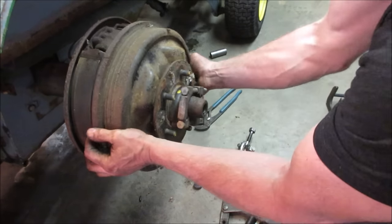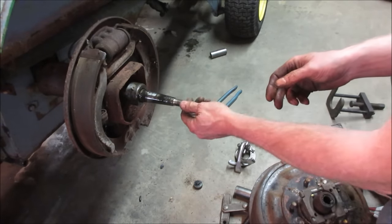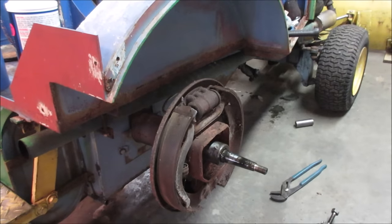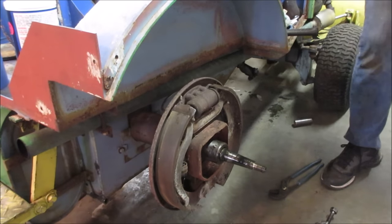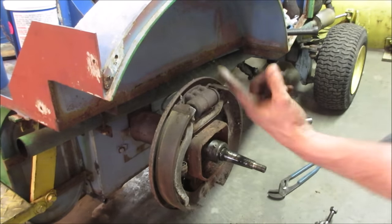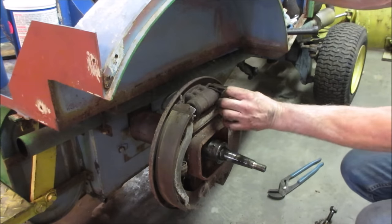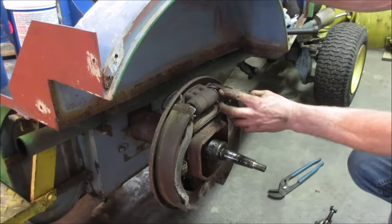You know, that's going to be nice and light, right? There we go. All right. So yeah, there's the taper shaft I was talking about. So we want to look at that wheel cylinder and hopefully we could save it. Let's go hit the brakes and see if anything moves. Yeah. So both of them are froze. And the other side, I guess, is working, but this was the same. Doesn't this look like the same ones that were on the Dodge? The Plymouth, rather? Yeah.